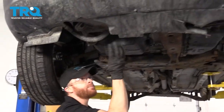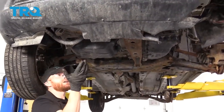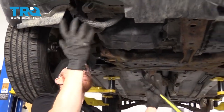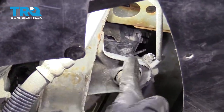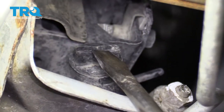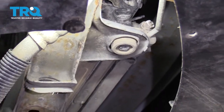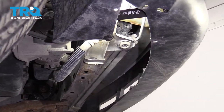To get started, the first thing we have to do is drain the coolant, so we're going to get underneath the passenger side. You might notice that you have some plastic shields under here. A lot of them are either broken or missing, but if you see a big shield, look for the mounting bolts and remove them all. Once your shields are out of the way, we're going to drain the coolant. Let's look right up inside the passenger side front bumper — you're going to see the petcock for draining the radiator. Make sure you have a nice collection bucket, hand protection, and eye protection, and then open that up and let it drain.